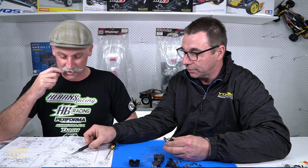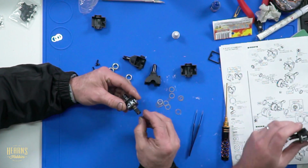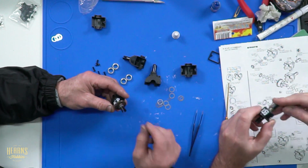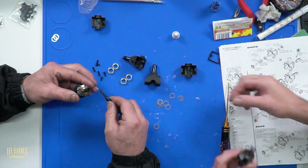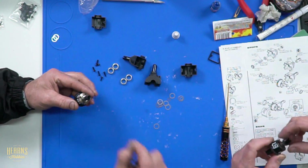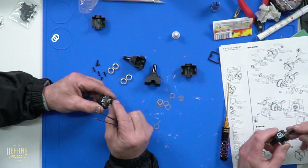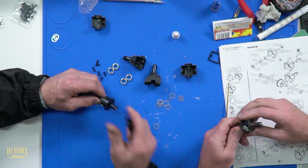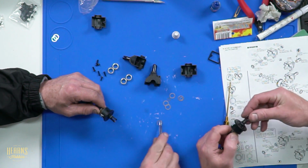Good for the digestion. On the non-crown wheel side, we use 2 shims of this thickness. That's the aluminium outdrive plate side. Yes, 2. And then you need a thin one on the same side. And then on the other side, you will need 3. There's 3.